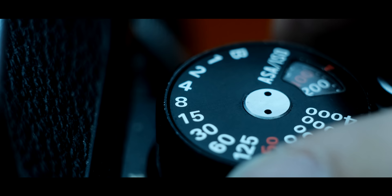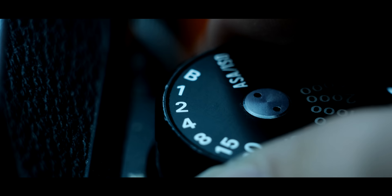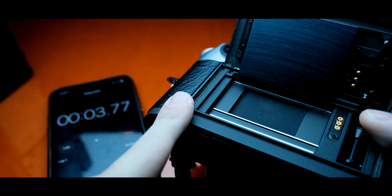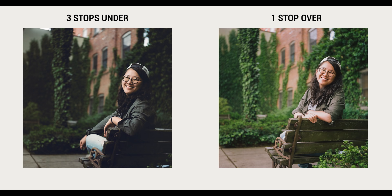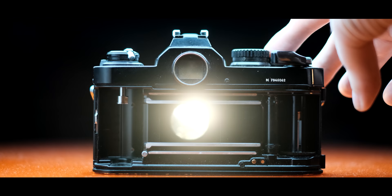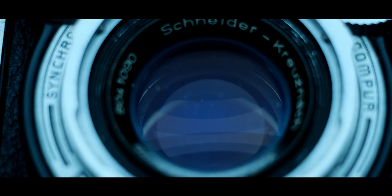A good way to check if your shutter speeds are accurate is to test the one-second shutter speed. If the one-second shutter speed is firing accurately, you're pretty much guaranteed that the faster shutter speeds will be working correctly. Just start a timer on your phone right when you hit the shutter button, and when that shutter closes, check if that was one second. If it's plus or minus a couple tenths of a second it's not a huge deal with film, because you can over and underexpose film pretty leniently before you see any issue.